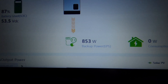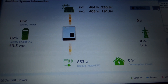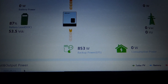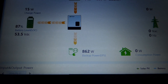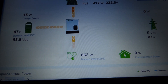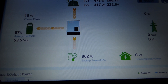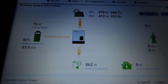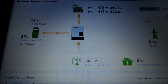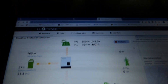After refreshing, that number went up to 853 watts — and as I said, an inverter AC slowly spools up. It keeps going until it reaches maximum demand. Refreshing again, it's gone up to 862 watts, and it will continue rising toward over 1,000 watts, because this is a one-horsepower unit (745 watts), and I'm already running about 300 to 400 watts between the two refrigerators, a freezer, and a fan. So total consumption should climb close to 1,000 watts once it fully spools up.